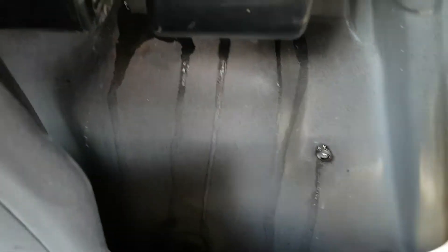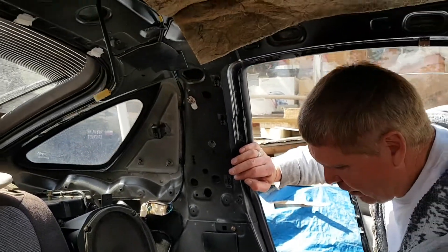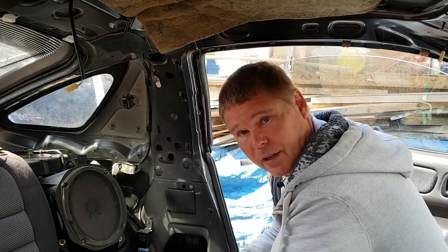This is a really common place for water to pour in when it rains, and it's an absolute disaster because if you've under sealed the bottom of your car and blocked the drain holes in any way, that water is just going to puddle in there and stay for months or years, slowly eating away at the bodywork. A lot of you are welding in new panels without dealing with the problem, and then in a year or two's time it'll be eating through again and you'll have to cut it out and weld it all up again — you're just chasing the same problem over and over.